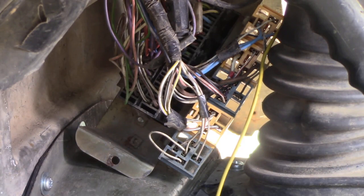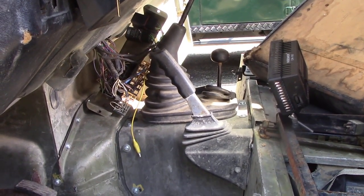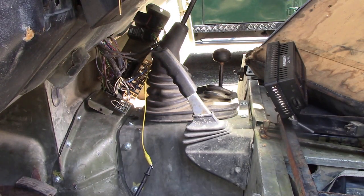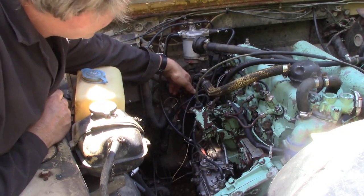That's good — we know there's continuity between those wires on the multimeter. I've put a jumper in the back where the red and white wire goes and we're getting nothing at all. So that's our problem — no continuity between the relay and that wire. I've disconnected it from the back of the starter so we're not touching it through ground.